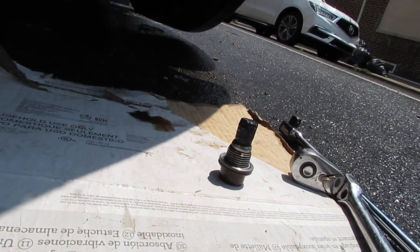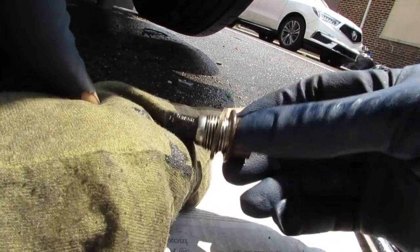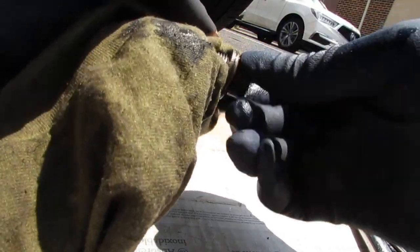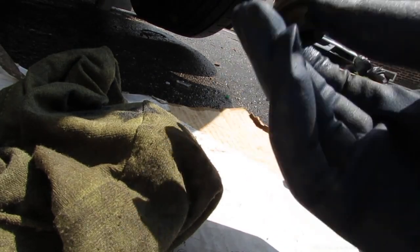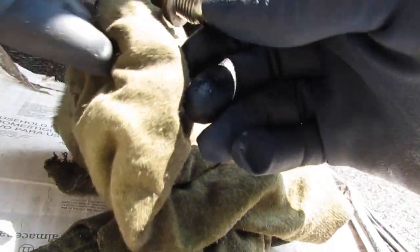So you can see here, the drain plug has a lot of crud on it, right? That's it collecting metal particulates. So there's a magnet there. These are all strategies to try to help prolong and protect your system. So I'm going to clean that off. There is a service interval for this automatic transmission, but I'm not really sure what the interval is. Maybe I'll flash it on the screen. But you should do this. You really should drain this fluid.